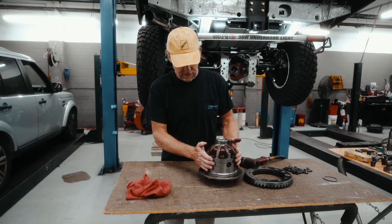All right, so we'll get an assistant. So hi, Edwin. Hello. You just want to get a block of wood or something, put a bit of pressure on the crown wheel. We're going to turn it, have the teeth mesh. We're going to go forward and backward. That way we're going to get the wear pattern on both the drive side and the coasting side of the gear, so we can see wear patterns on both sides. So you put a bit of pressure on there. I'm going to turn the pinion back here. So we're going to just come around so that it meshes with the pinion.